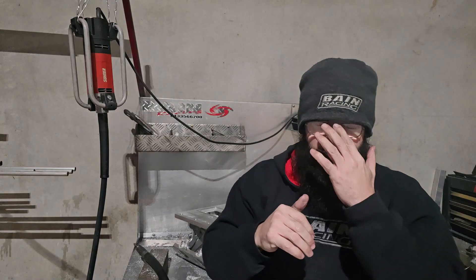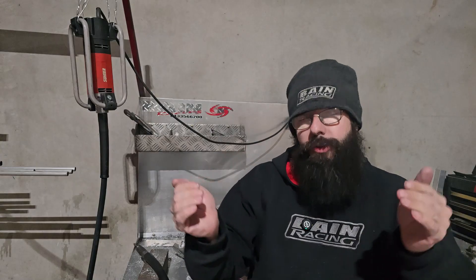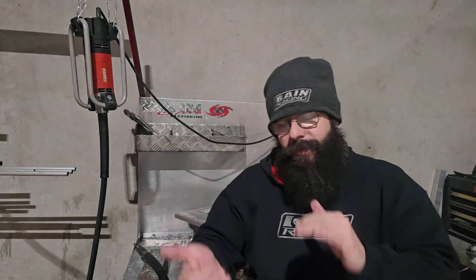I want to improve wave strength but also get maximum flow into the runner, which is why I don't use a full radius — I finish at 70 degrees. You'll see this in sprint cars with trumpets, and Formula One uses a dual-stage radius to harness the wave effect. Some V8 Supercars use hard-edge bell mouths. The goal is to stop separation, stop the vena contracta — keep that 'waterfall' connected — and get a clean line for the shock wave recoil coming back up the runner.